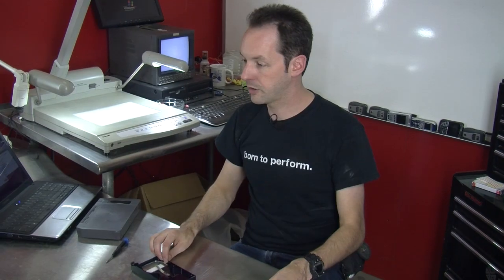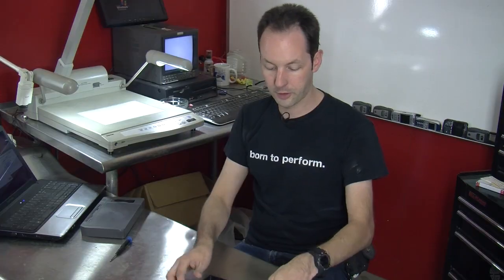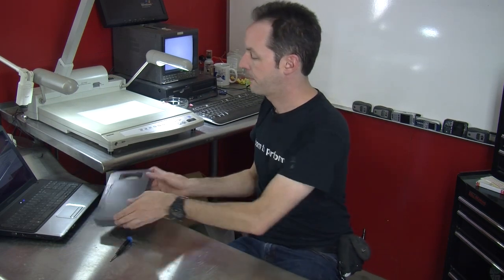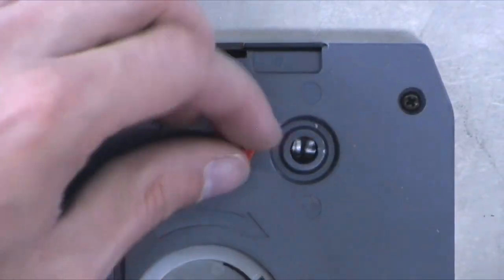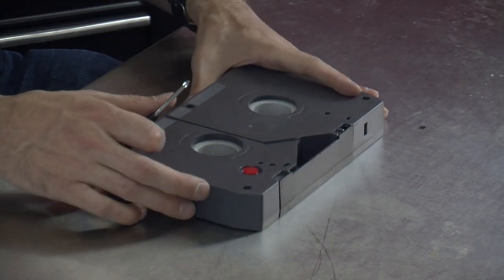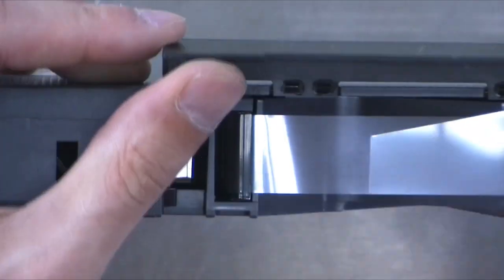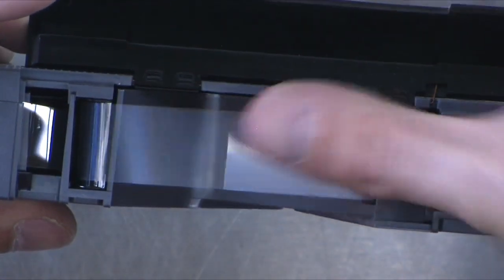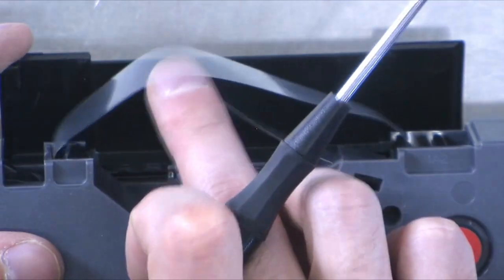So that's inside a video cassette. There are a couple big springs to push everything down, and then there's the spring for the door, because they have a hatch on the front. That's a standard Betacam SP. Now this is the big U-Matic. Look — see the big R? That's the record-protect notch. If you want to decide if you can or cannot record on here, it depends on if there's the big red button, which is very easy to pop out without tools — and you can replace it by just pushing it right back in, it locks in place. There's a notch on the bottom you push to open the door. Look at how wide the tape is — this is as wide as my thumb, it's three-quarters of an inch. It's huge tape.